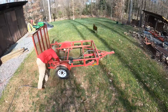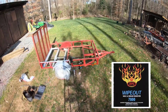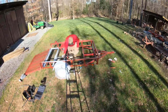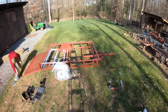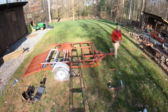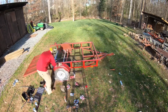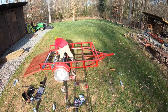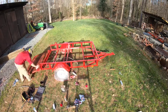I let the trailer dry, and before I applied any kind of paint, primer, or anything, I wiped it down with a product called Wipeout — it's a wax and degreaser. It does a good job; I use this on several projects. It's a great idea to wipe down your project after you wash it, sand it, or whatever. This wax and degreaser takes fingerprints off and allows the paint to adhere better.